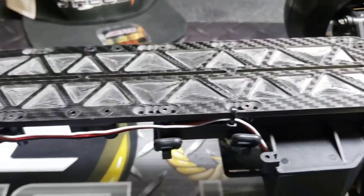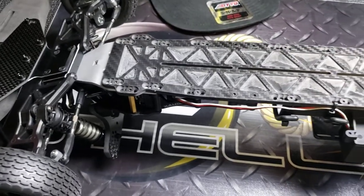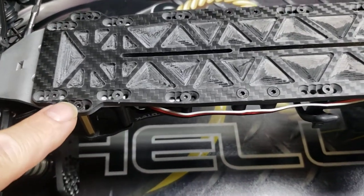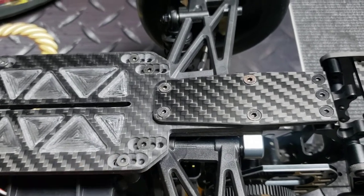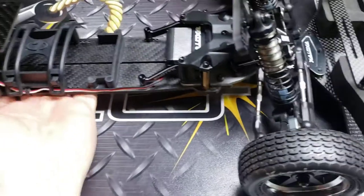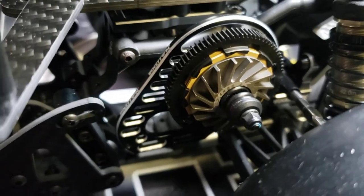This was the Swiss chassis, so this has the pocket cuts and is fully adjustable. This is going to do a maximum wheelbase of 13.5 inches. Close to the stock wheelbase is going to be in the third hole position back from the front and the third hole position back from the rear — we've brought ours up slightly. We're running the Exotec turbine slipper in this vehicle, which utilizes either Exotec or Associated's Octolock spur gears.